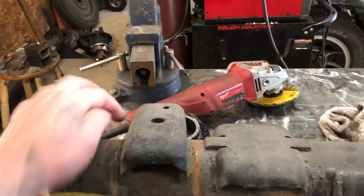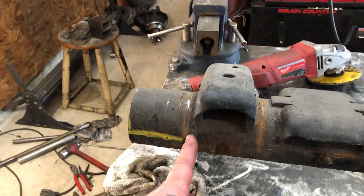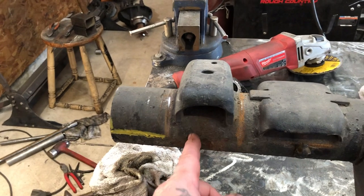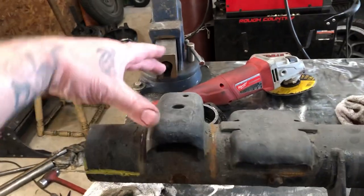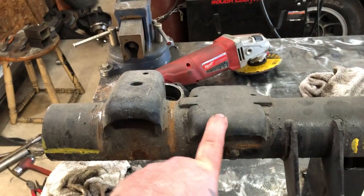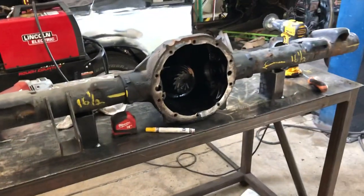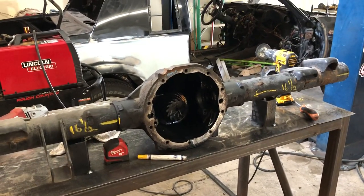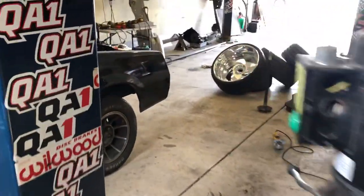This perch is going to be moved in an inch and a half, so I've got to cut this off, move it in, then make my second cut here to get rid of the four inches. I left an inch on the back of that, so I'll be at the five-inch mark. It's got to go over an inch and a half and stay in the same position. I never look at jobs as little and simple — you start doing that and you run into a lot of problems.